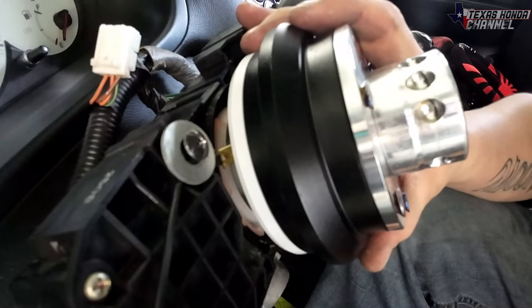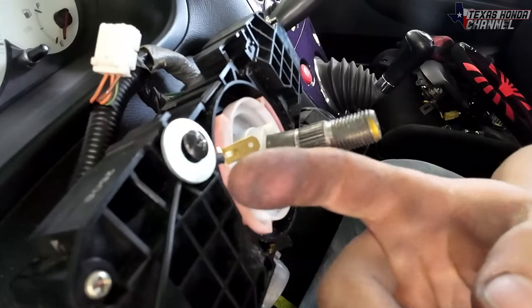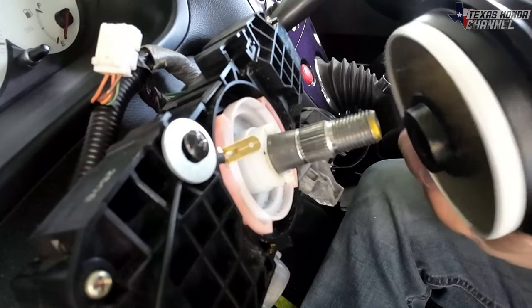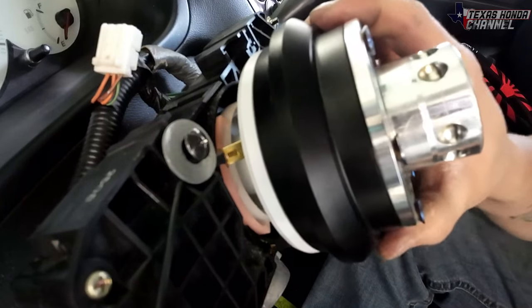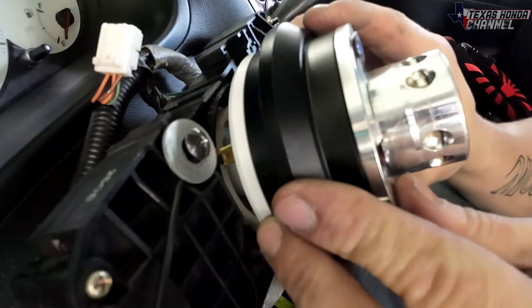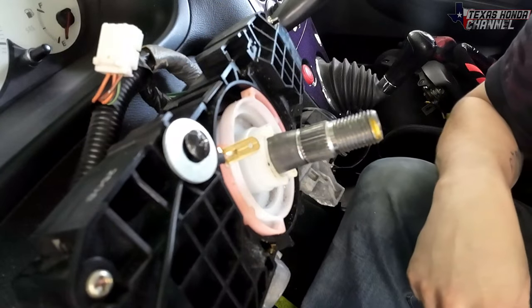You can do this many different ways — you can use something like this, or just get a piece of brass. I prefer brass since this is brass, so it doesn't make a lot of noise from metal-to-metal rubbing. This method should work pretty good. Now we just have to take this little piece off, bolt the hub in, and before you do all that make sure your steering wheel is perfectly straight up and down.